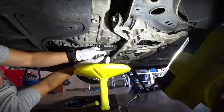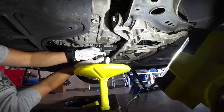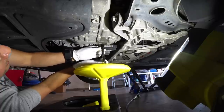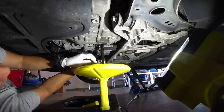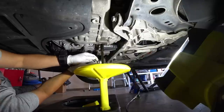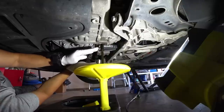And this one, you definitely want to loosen with your finger. There's no need, as you can tell, you can slightly see that socket there. And I have left my Allen just like that so the fluid will come on out. So it's a little easier, it doesn't quite splash as much, and once it stops, we'll go ahead and remove this plug here.